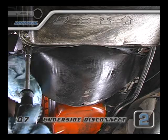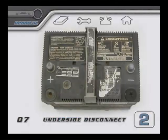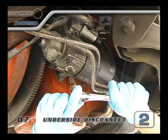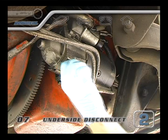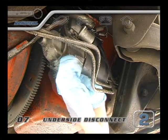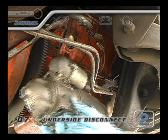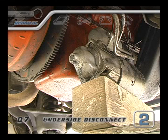If you have some type of bell housing or torque converter cover, you'll need to pull it off first so you can get to the starter. Do a quick double check right now and make sure that your battery is disconnected. Then, start to back out the starter bolts alternately until one of them comes out, then thread that same bolt back in by hand a few turns. Now you can remove the other bolt completely. Then push the starter up all the way and remove the remaining bolt by hand. Be aware — starters are very heavy and the wires that connect to them are usually not very long, and you're under the car with limited leverage. You might want to have some type of box and blocks of wood to support this heavy little guy as it comes loose.